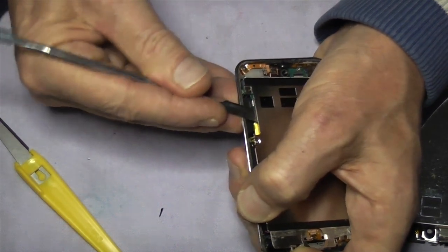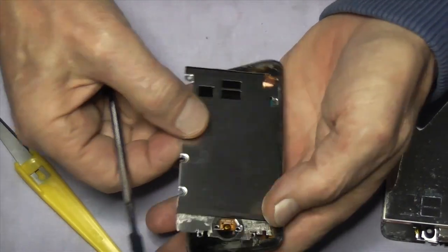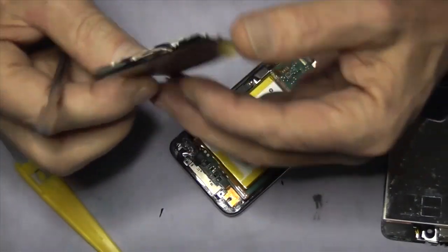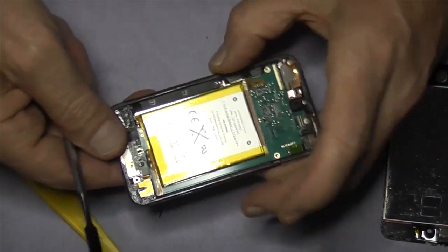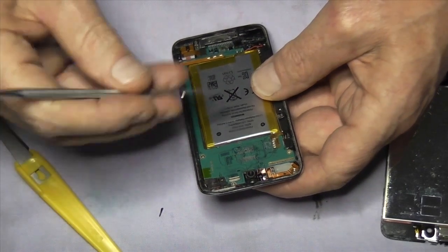So if it won't all come, just get in there, just prise it up very gently, and hopefully you won't have damaged that ribbon cable, which incidentally is for the volume control and the on-off. There's four little solder points on there, which I'll show you in the next video.